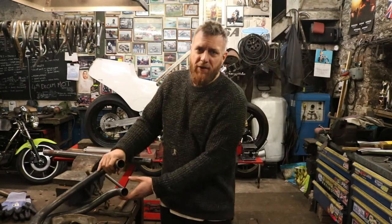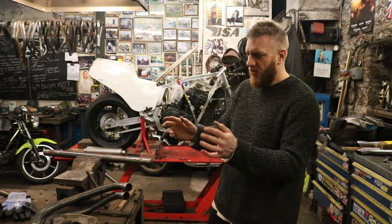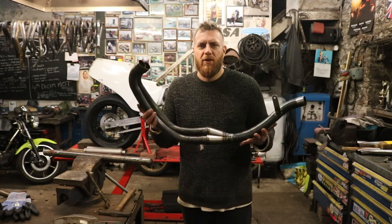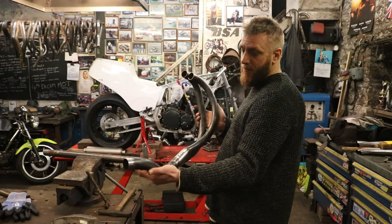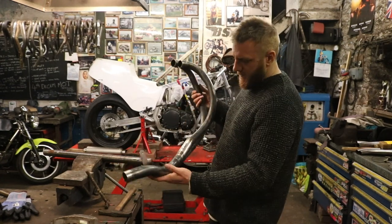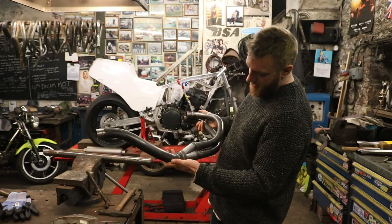Then I've got the pipes off here, you can see them. Weld up spring hooks on them, so I've marked them all up. They're still like this. I've took them off in 2 halves. So that's the right hand side of the engine and the bottom pipe on the back. Other set's obviously the other side. This I've marked them up here, so I'm going to put a spring hook across there.